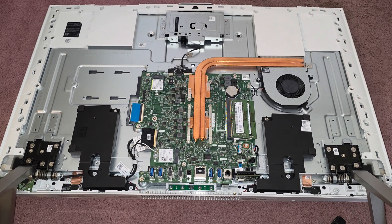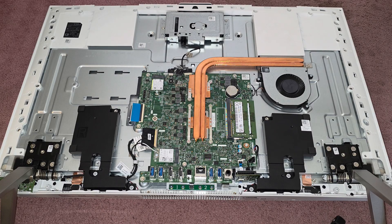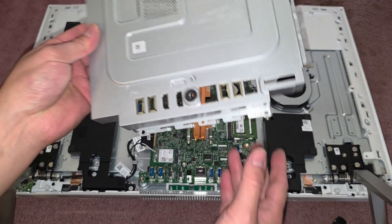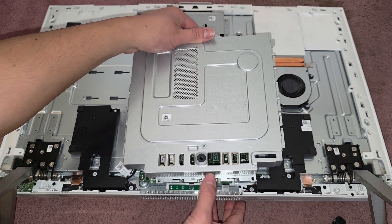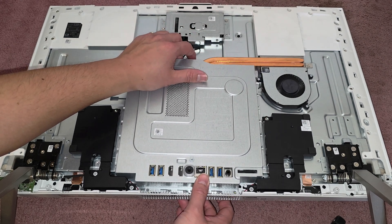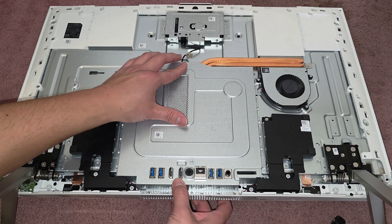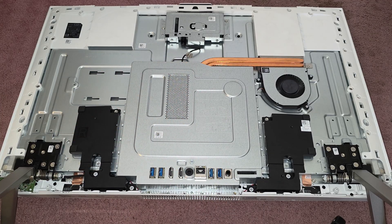I'm back. As you can see, the fan is all clean now. Let's go ahead and reassemble this thing. To reassemble, basically just slot everything back in — line it back up, carefully lower it down. These little foam pads are what make it difficult to go back in. Then we're going to go ahead and get the hard drive back in: this goes like this and it slides in that way.